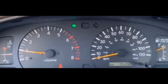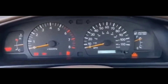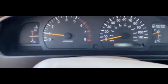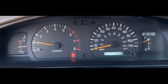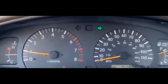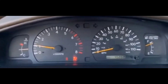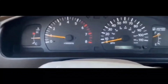At that point I figured it had to be either a fuse, a relay, or the starter — though I didn't think it was the starter since it had been changed out about a year ago. I got to the fuse box and checked the fuses, looking at the tops to see if any were blown or had a brownish color, or if there was any burnt smell coming from the fuse box. I didn't have a fuse tester on me, but I didn't see any that looked blown.